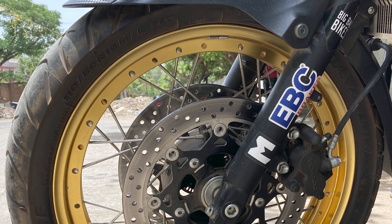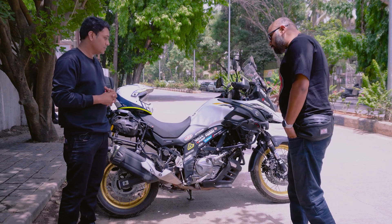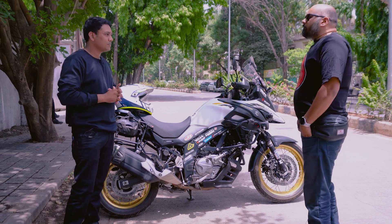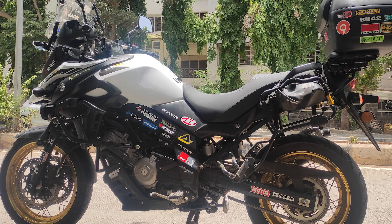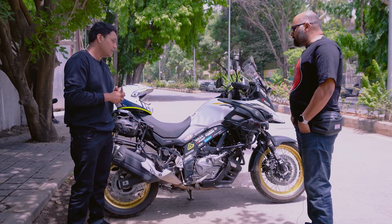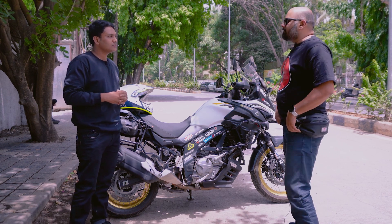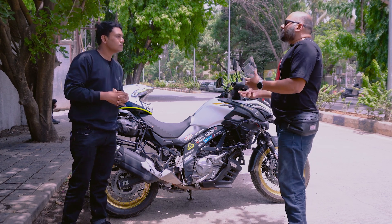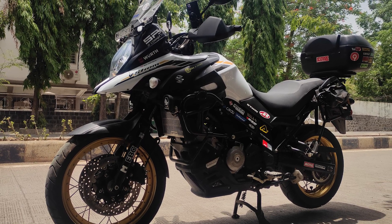The reason behind that is if you see the spoked wheels — they are not alloy, sorry — spoked rims, but they are tubeless. So that enhances your off-road capability: if you get a puncture on a rough road you can still manage, plus the spokes give flexibility for off-roading. This was one main reason for me — the off-road capability and the spoked wheels with tubeless facility — that was quite an important decision-making factor when choosing the bike.